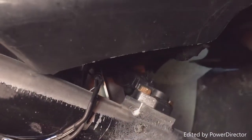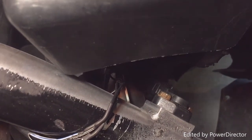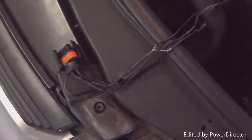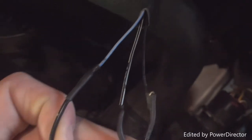It's still on the side and if you can see it right there, that's what it looks like. So usually that'll be on the top of the intercooler, and you're going to have to unplug it and get those wires out here. Now that you've got that unplugged, you will usually have three wires: a blue wire, a white wire, and a black wire. Those are the three wires you have to tap into. You don't have to tap into the white wire actually — all you use is the blue and the black.